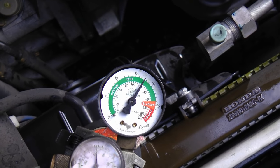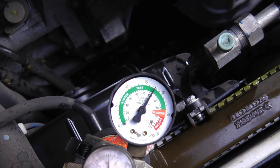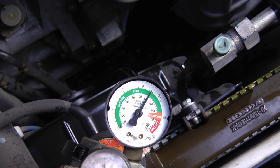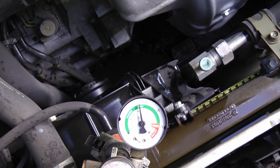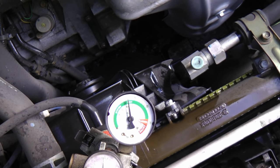Now this case is pretty easy — there was a hole in the radiator. But if it's more complex, you watch the pressure on the gauge and see if it starts to move down. Pump it up to about 16 pounds pressure or so and watch the gauge, and if it starts dropping like this, you know there's a leak and you have to find where the squirt is coming from.